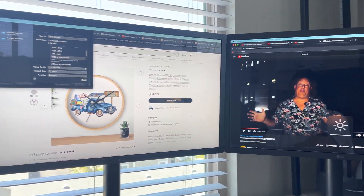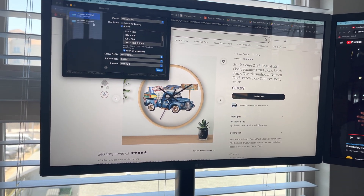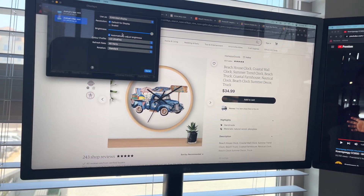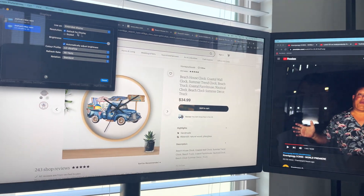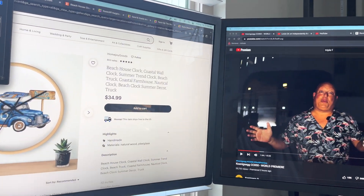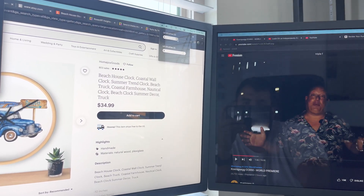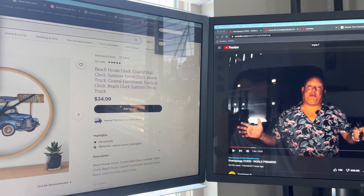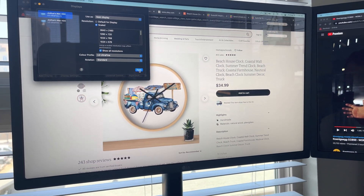Something you will not have, however, is brightness control on both displays. If you lower the brightness from the keyboard, it only does it on one, and you don't have the option in Display Settings in System Preferences either. You have brightness control natively on the Thunderbolt 3 display, but not through the Sig adapter. There are, however, applications that allow you to control the brightness, so you can control it via that.